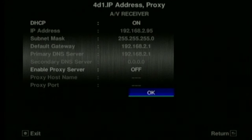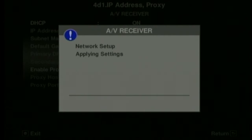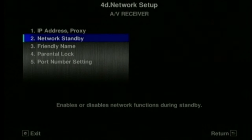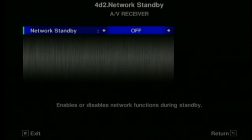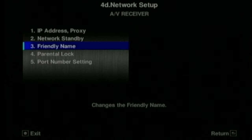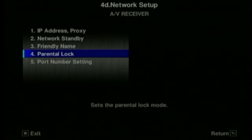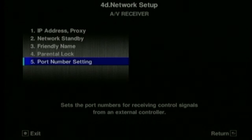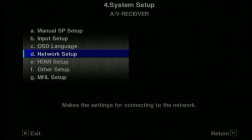There are network settings as well. If you've got problems with networking, we always recommend changing it to a static IP address rather than using the DHCP server. Network standby is important if you're going to use the app to control it or anything else that uses IP control - you want to switch that to on, otherwise you won't be able to turn the amp back on once you've turned it off. This is where you set the ports for controlling the app - by default it's port 23, which is what the Pioneer app uses.